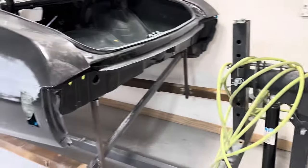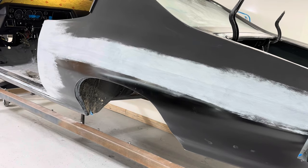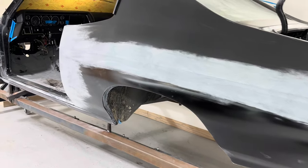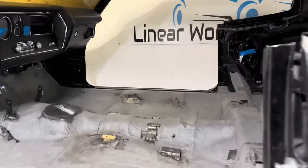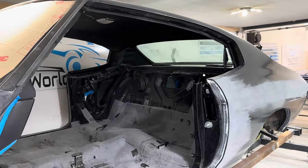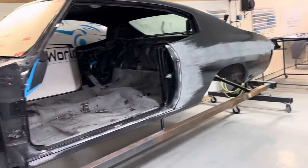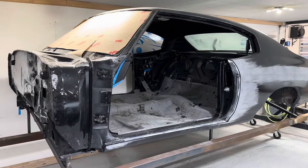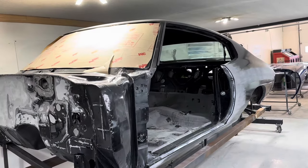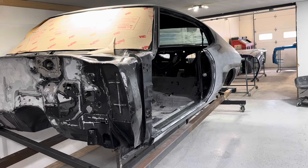We didn't disassemble the entire chassis — the chassis was pretty nice — but we did a lot of upgrades. We put QA1 suspension on it, pulled the 454 out, freshened some things on that, repainted it, and put a TKX 5-speed in it. We put a 2017 CTS-V interior in this one — seats, center console, all that kind of stuff. We've got an appointment at the upholstery shop the first week of May to get the headliner, package tray, and all the interior panels done. Then we simply bolt our 17 Cadillac seats in, dash goes in, and we're done.